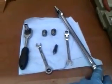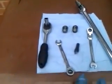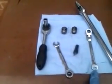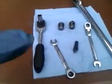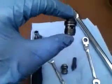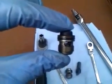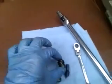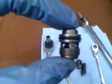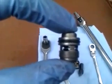You do need the length of a 3/8 breaker bar to initially break the seal, but after that I suggest an 8mm socket, 8mm ratchet ring spanner, open-ended spanner, or any such tool. When you get the valve out, you can see that on the old valve the outside diameter of the oil seal is very similar to the outside diameter of the valve. On the new valve, the outside diameter of the O-ring is about 2mm bigger than the outside diameter of the valve, so hopefully there will be some good sealing there.